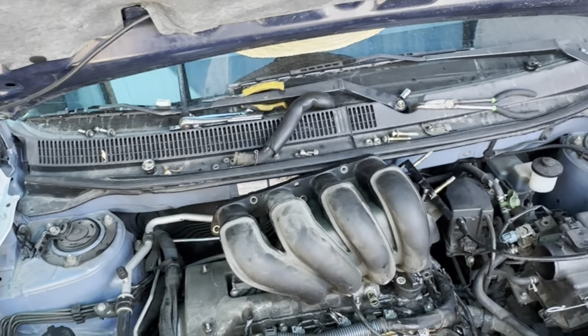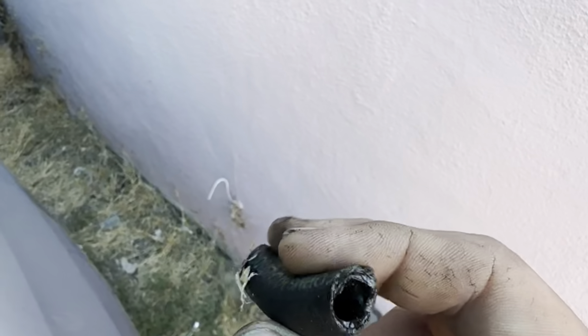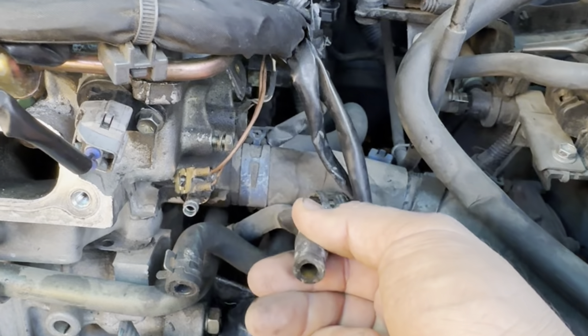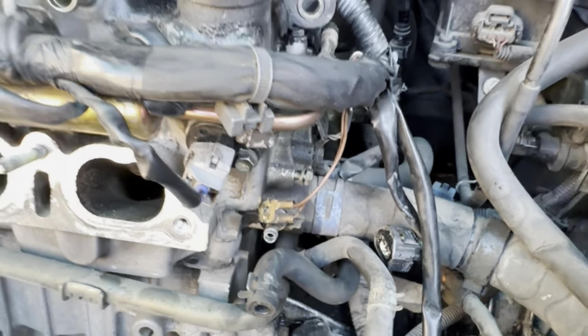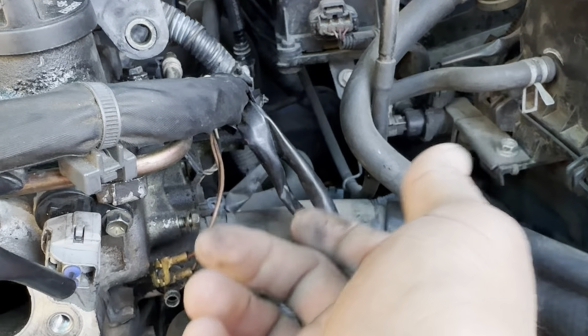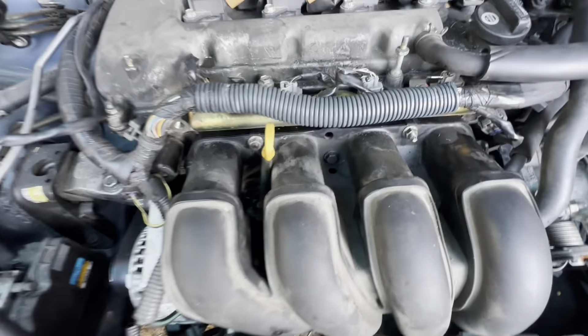She's now almost back to stock. I'm going to check a couple of these hoses because they dry-rotted — right here, the coolant hose for the throttle body dry-rotted, it's really hard. I gotta see if I have a hose in the garage. I'm going to replace that hose, clean up this area, get some Tesa tape and wrap these wires so they don't get brittle from the heat. Whoever installed this didn't do it right — they left a bolt out so oil was just leaking down. Supercharger is going on my dad's car, so I'm gonna do a whole series on that.